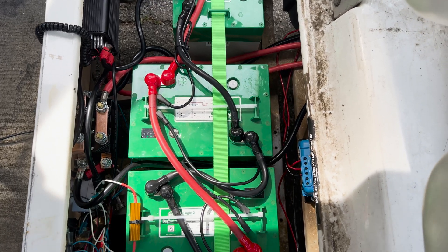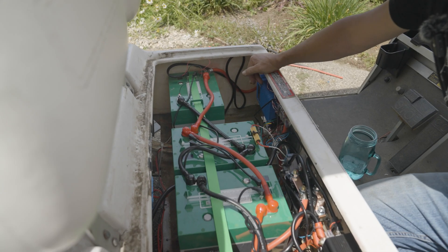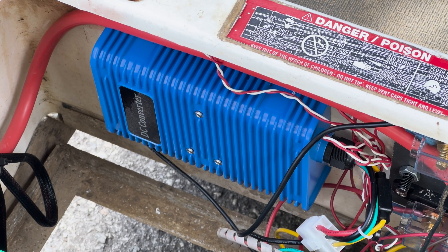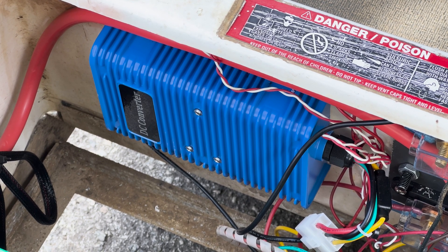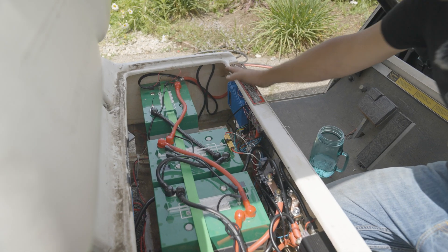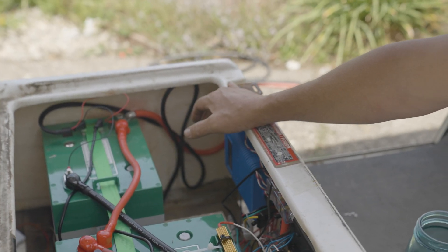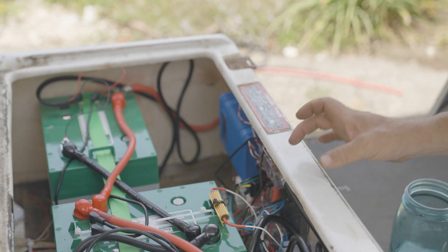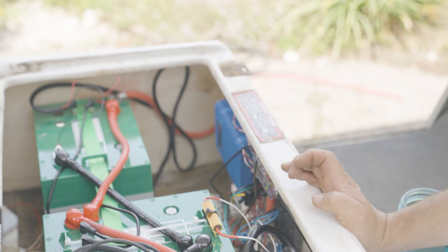He's going to be swapping out a controller in it. Let me take you through the components here. On my right is that blue device — there is a DC-DC converter. It works for both 36 and 48 volt main packs and steps the voltage down to 12 volts for any of your 12 volt accessories. So basically when you turn the key on, this is activated — it already has 48 volts but it's not enabled yet. The key switch will enable it and then it'll give 12 volts, which will turn on our main contactor, and the main contactor gives power to the motor controller. So then we're live.